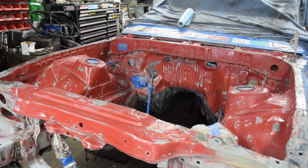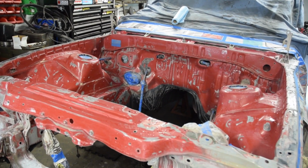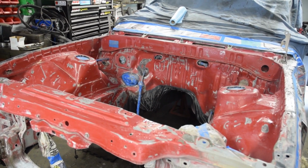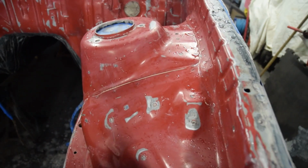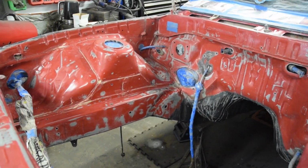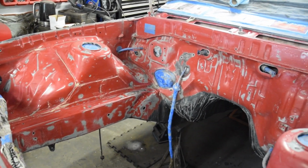So I then had to get a big pot of very, very coarse 2K thinners and just wipe all the rattle can gold and white primer off it, so I could have something that wouldn't react to the paint. But as you can see, it looks a lot better now. So now we'll prep it all over again and do it again.